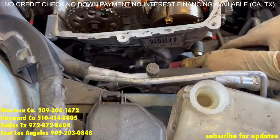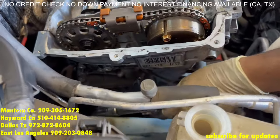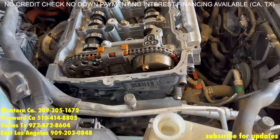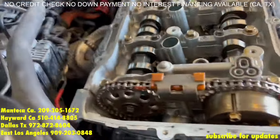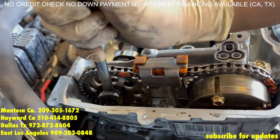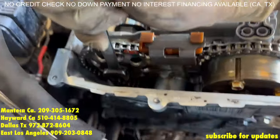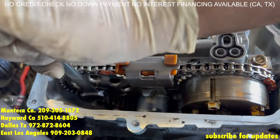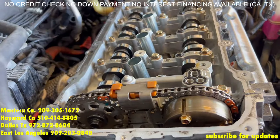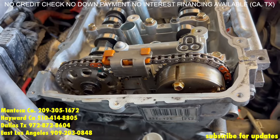As you can see now, Manuel is tightening up all the 14s and the 12s and the one 10mm bolt that attaches the timing cover onto the block. Now the important step — we're going to activate the timing chain tensioner. Manuel has a 14mm wrench, he's going to pull back towards himself. That compresses the tensioner and then he releases it — and you would have heard those clicks if I wasn't talking. But the timing is set now.